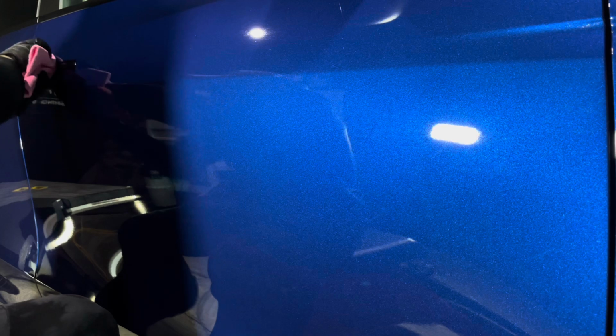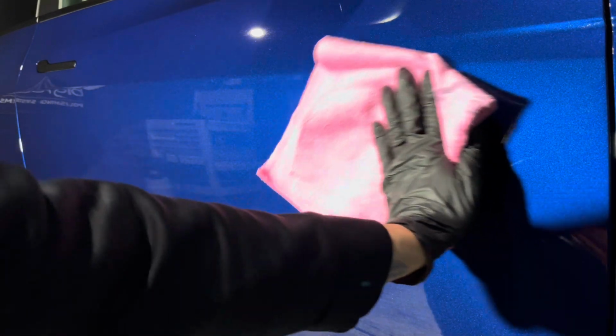Just wiping the door handle here. I'll coat the door handle with HPC. And what I like to do as a test spot is, if it's grabby, that means you're a little bit too late. If it's, you know, easy to wipe off like you're pushing coating, that means you're a little too early. And I am going to do a quick wipe and see how it feels.